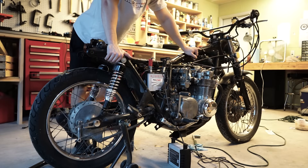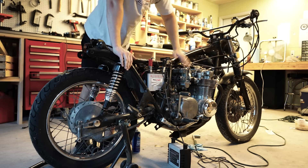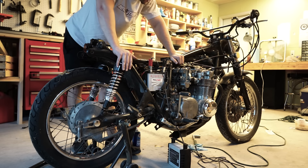The carbs are all cleaned out - they were super clean already. I'm thinking there actually hasn't been gas run through these carbs since they were rebuilt by the last guy or the company he sent them to. They do have 110 main jets in them already, which is exactly what I would put in to run on pod filters. So I put them right back on and it should be good.